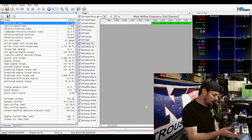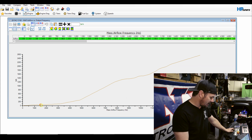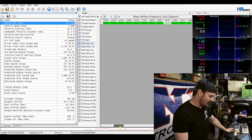Let's take a look at the logs. We've got three different logs pulled up here from tuning the MAF and making adjustments. Let's look at the actual tune first — here's our start-off point going into this process. A little bit rough down low but nothing bad. After making some applied changes to try and enrich it — because it was showing that we needed more fuel — we got a nice smooth curve up top. But looking at the actual data itself, our first log is saying that we've been 10% too rich pretty consistently — that's probably a bad cell of data.